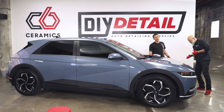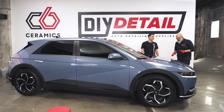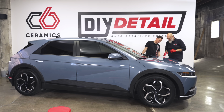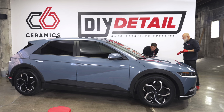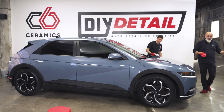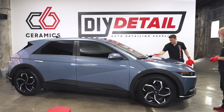It's really just, my head is like, how did this shop 2 hours ago have the coating flash so quickly, and now it's still hanging out. Right, because of the humidity. The temperature hasn't changed, the humidity level has. If you remember before, the floor was soaking wet from us having washed the vehicle. Now we just have a few little puddles here and there.